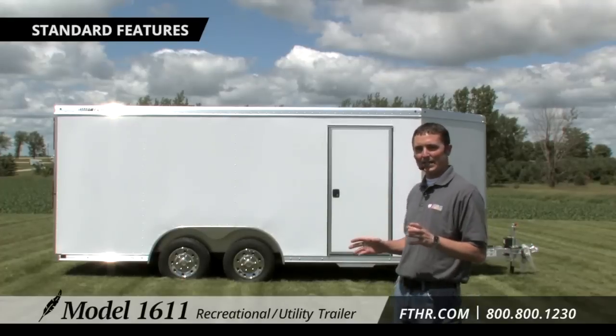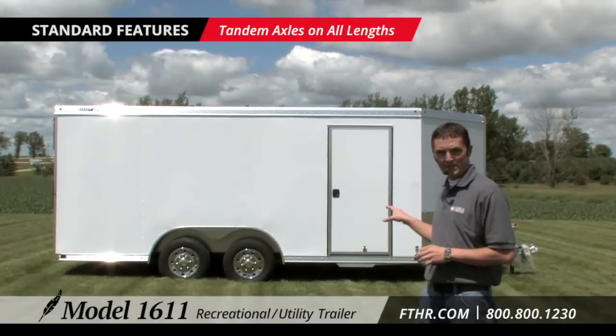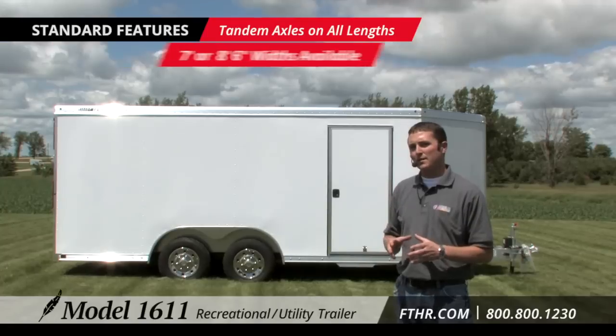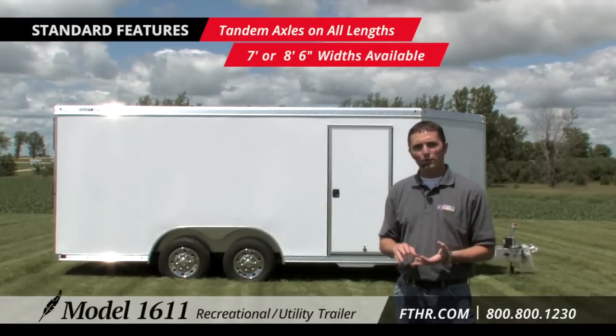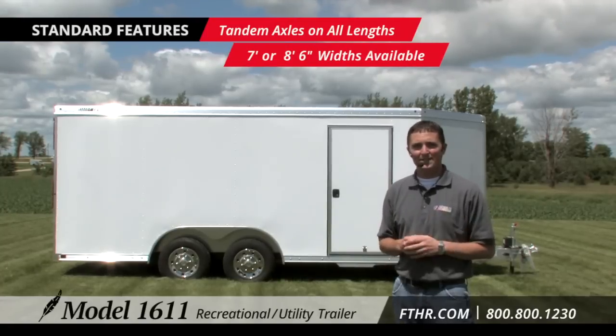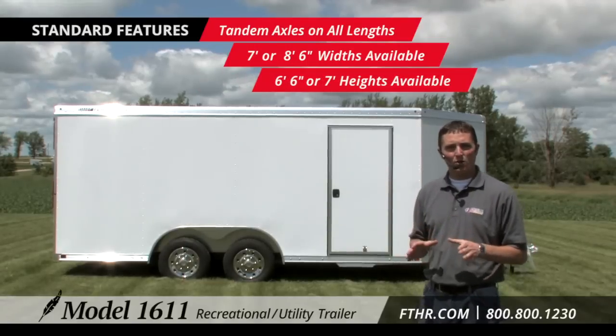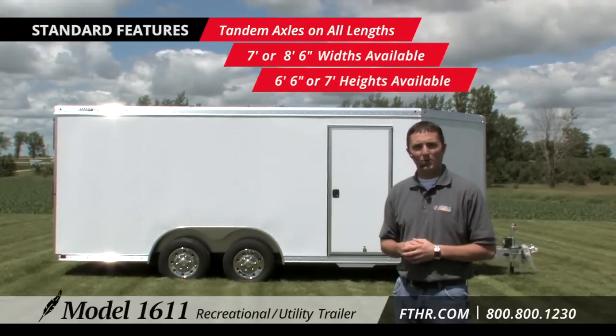The 1611 is going to come with tandem axle setups on all of its lengths, from 12-foot all the way up to 18-foot. You'll also see that this model is available in 7-wide or a full 8.6 wide, which is different than the 1610. Height-wise, it's available in 6.6 or 7 tall. All of these are to help maximize your cargo area.